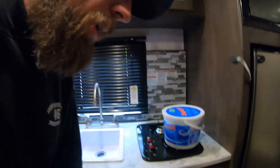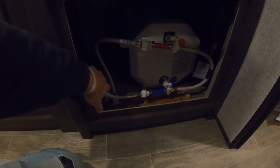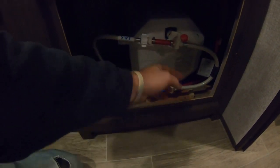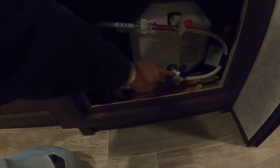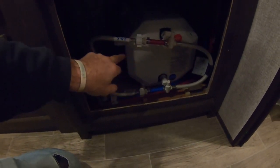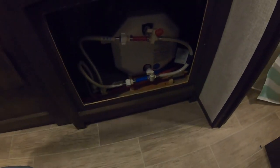On the 17B you shouldn't have to add an add-on kit — it's already in there. I'm going to show you: you just take off the panel under the refrigerator, it's just two screws. The bypass hose is this loop right here. Typically water comes in, goes into the water heater, heats up, then comes back out the hot spigot and into the water lines. This bypass just shuts off that path, turns it into a loop around the heater, and sends it back into the water lines — it's pretty much just for winterizing.